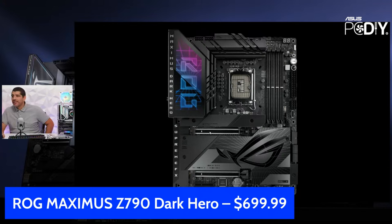You can also see things like the actual slot spacing for the GPU is quite a bit different, where it also supports dual high-speed PCI Express Gen 5 slots, where most of the other motherboards you're going to see only have one slot, and then the other slot wouldn't be a high-speed secondary slot. The advantage to that, too, is sometimes what we find is that some users, for different reasons aesthetically, maybe they'll mount the GPU here versus mounting the GPU there.